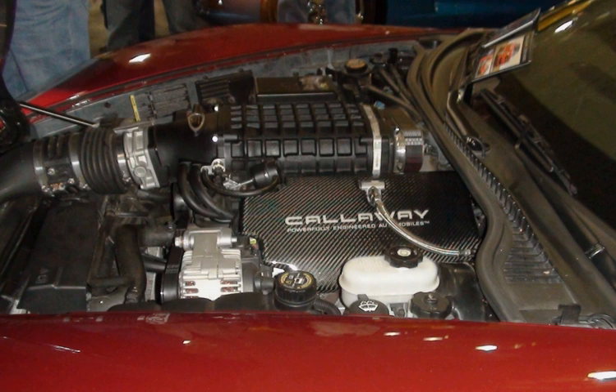The 2009 L-92 was modified with flex fuel capability, becoming the L9H. In 2010, the L9H was further modified with active fuel management, becoming the L94 in the Cadillac Escalade and GMC Yukon Denali. Interestingly, active fuel management hardware was present in 2007 engines, but the software was not enabled in the PCM until May 2010.